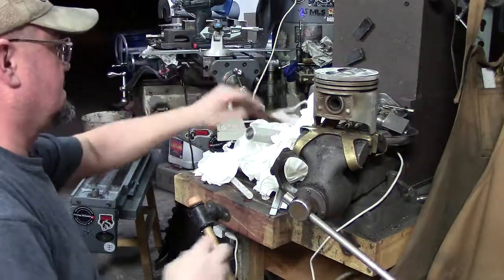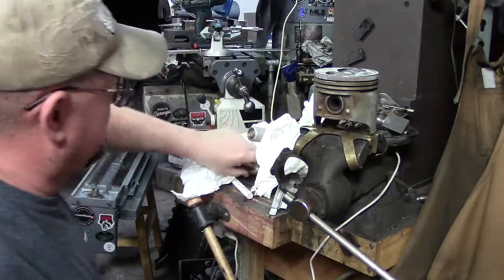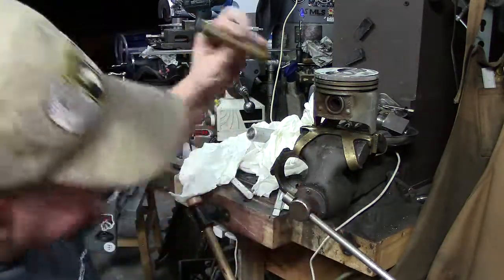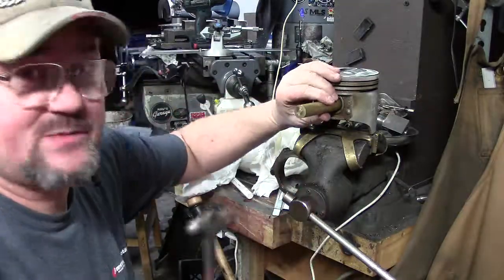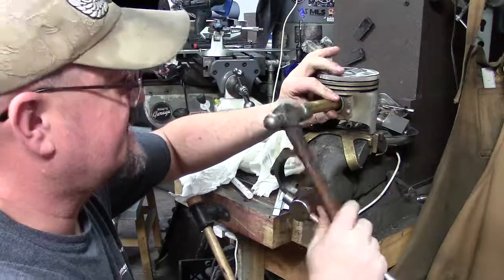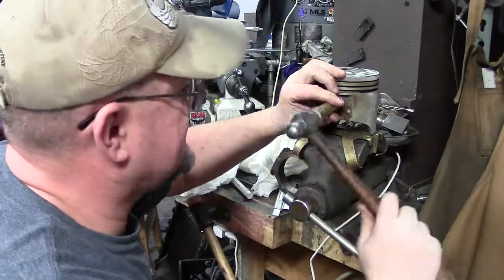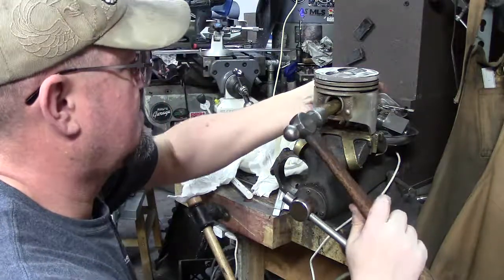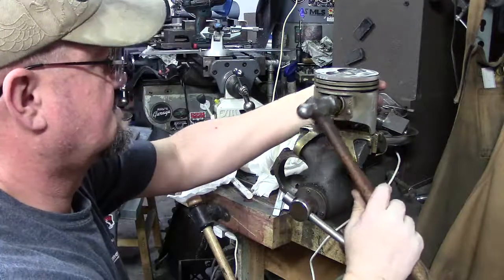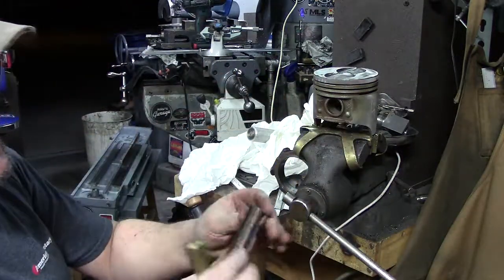Make sure I'm not hitting anything. Hammer. Brass drift is right here. I've got that valve body covered up so I don't get junk in it. Just a piece of brass up in here. They are full floating, but you have like oil residue that keeps them from sliding easy. They just slide right out. So, not a showstopper, nothing damaged.